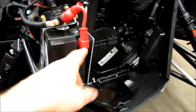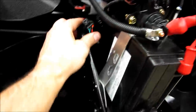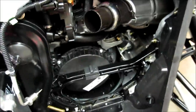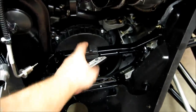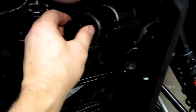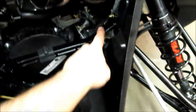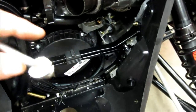Battery's all in. On this side there's just the one on the positive — make sure if there's another wire that they both go under your bolt. Battery is all tight and snug, and speedometer pickup is plugged in. Next step is putting on the suitcase muffler — the big thing is to make sure the bracket goes over the rubber stopper, gets down in the hole completely, and is over your pipe with the gasket still there. You have some play in the pipe to move it around. Then put on the four springs and the pipe temp sensor with the locking ring.